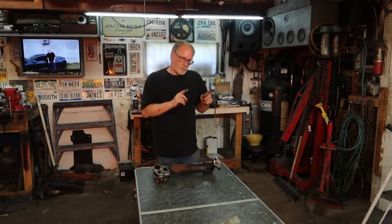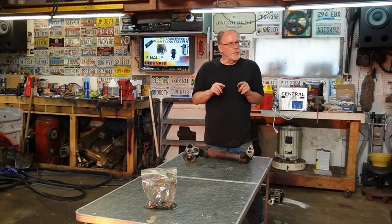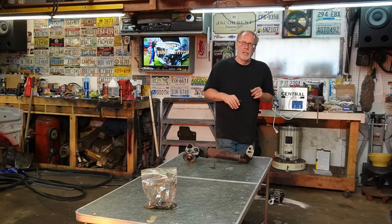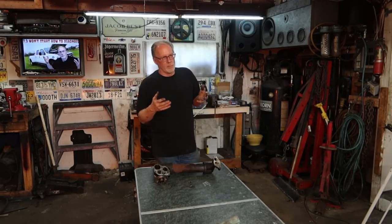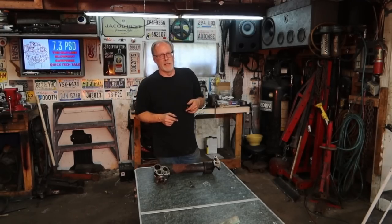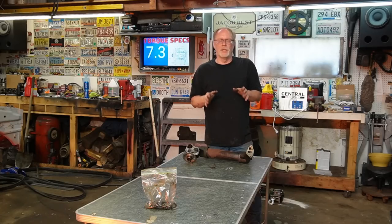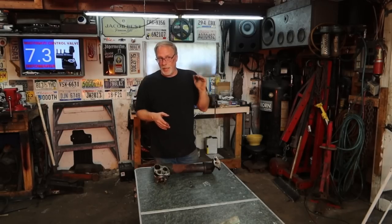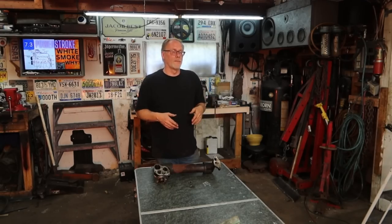And the other reason, if you do a lot of towing and you're not doing oil changes at 3,000 miles. I see the comments some of these guys put on my debunking videos, saying it's still all full of black oil. Well, you have oil burn off, and I can guarantee it's sitting in the pan, in your rings, all over that engine, because you're under heavy load. If you're doing constant, regular towing with your 7.3, that oil interval is normally 5,000. You need to bring that down to 3,000. That is the cost of heavy towing. You've got to change your oil more frequently.